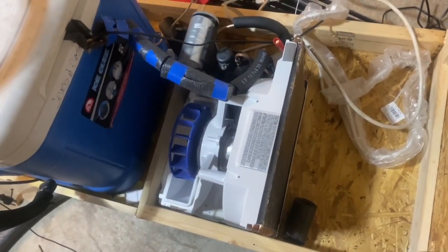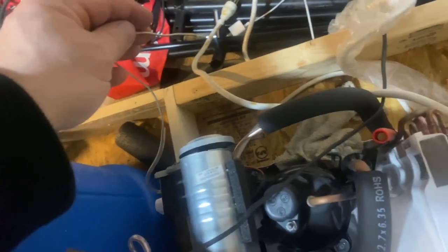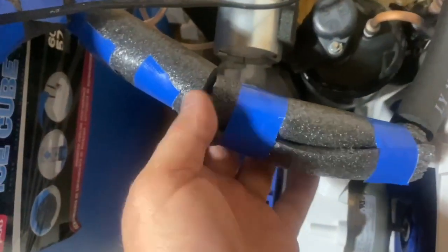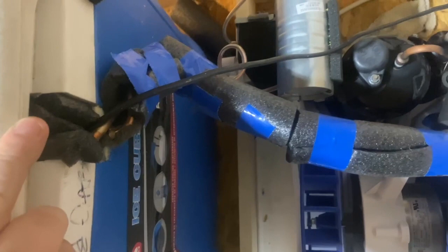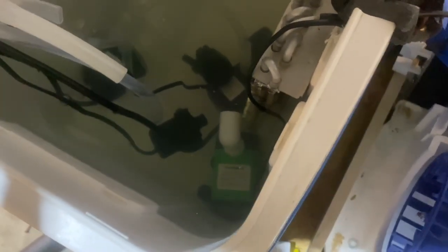Sorry about the mess out here. What you do is take the casing off of the air conditioner, then pull the temperature sensor — it'll be on the condenser — and leave it there so it can't make the AC turn off. Then you take the evaporator coil, which is under here. I wrapped it because it does have some water drip off of it. You just carefully straighten it out, bend it however you want, and I ran it into a cooler. Inside my cooler you can see my glycol pumps, and I've also got a recirculation pump in there to keep it moving around so it stays cold all around. The evaporator is just sitting in the glycol.